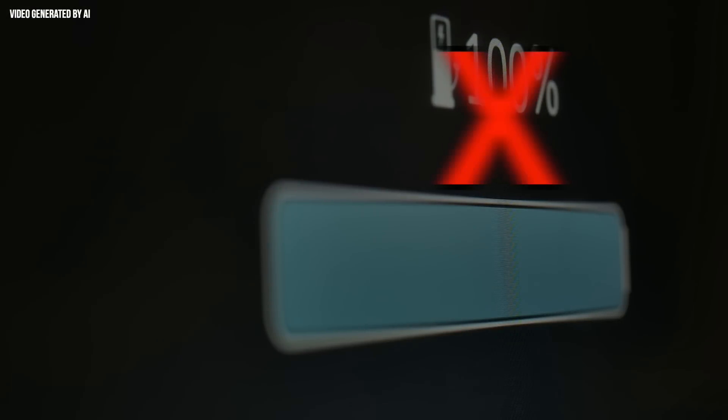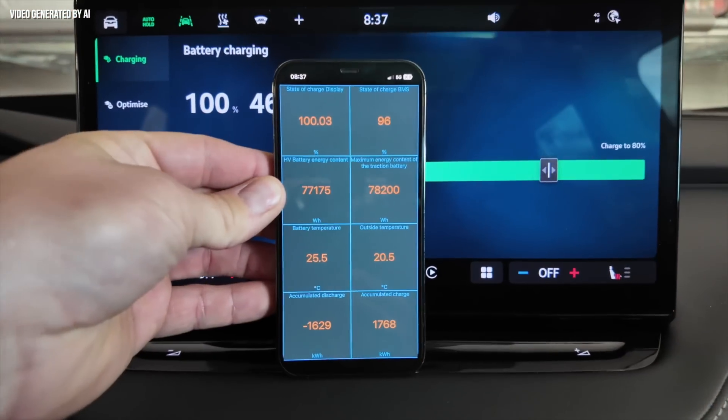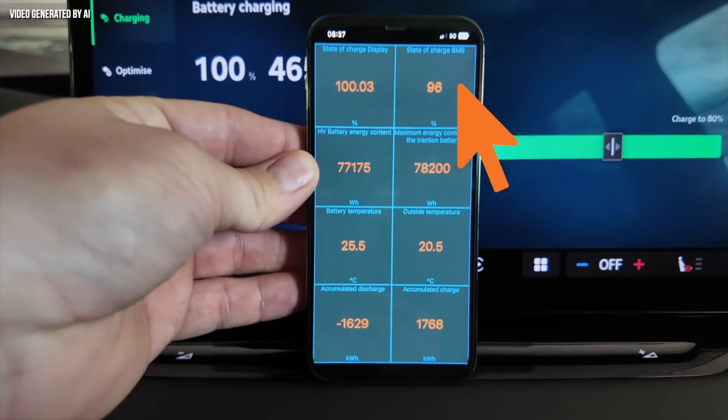As a result, the battery chemistry remains more stable and the service life is significantly extended. The next tip is also the most important one: if it is not necessary, do not charge the battery to 100%. Charging up to 80% is often sufficient in everyday use. The Enyaq only charges its battery internally to 96% and not all the way to 100% — this is why, among other reasons, there are gross and net figures for the battery. Nevertheless, it charges well over 80% and this is crucial for degradation. NMC batteries should only be charged to 100% if it is really necessary, for example before long journeys.